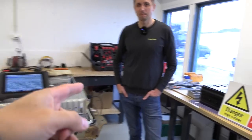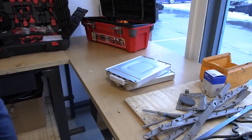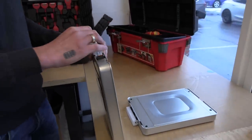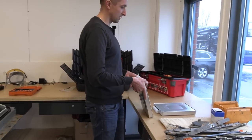Here we have some secondhand modules — not new cells. New cells would not work well on an old battery pack because there would be too big a difference in capacity and internal resistance, so the battery pack would not function optimally. When replacing cells, you need to find used cells that have driven approximately the same kilometers and have approximately the same capacity as the rest.